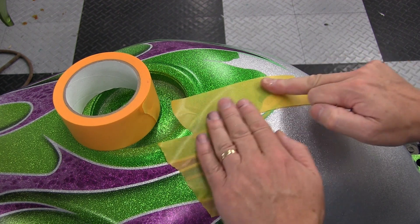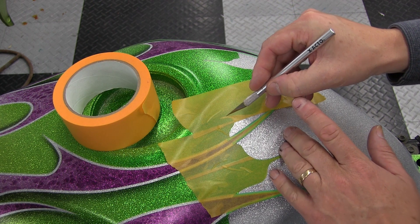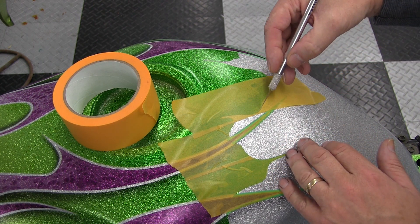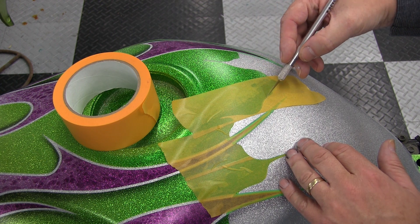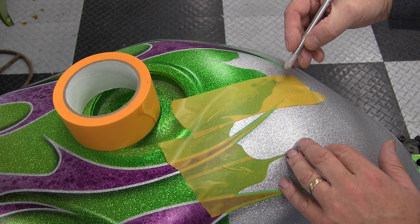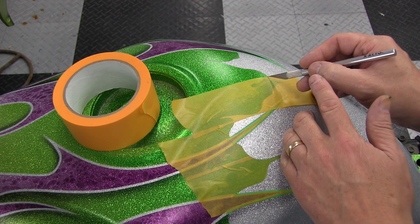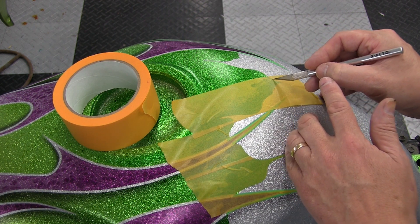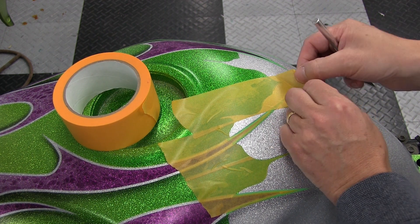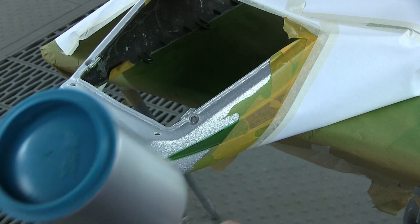Next up I'm about to reverse mask, and this has only been sitting for about an hour and a half to two hours. The paint will literally dry that quick — within two hours I'm coming in with aggressive masking and cutting directly onto the surface. The UVLS in the candy will let you do that, but keep your wits about you: nice sharp scalpel blade, take your time, and please don't lean too heavy. You really could cut into both the candy and the clear. Once I've got everything back masked and I'm happy with it, I'm just going to come in and neutralize this.